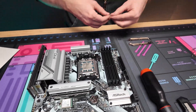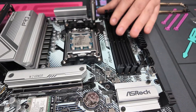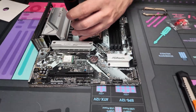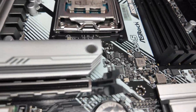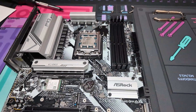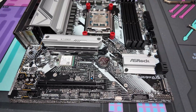AMD motherboards come with little brackets on them that we need to take off. That's four screws to remove. Those are the little stubs that we're going to be resting the red standoffs on. Now that we've got those off, it should look like this — four different places to rest the standoffs. You're just going to rest all four of the red standoffs on those now-exposed little stubs.